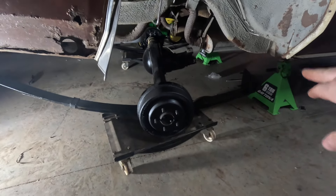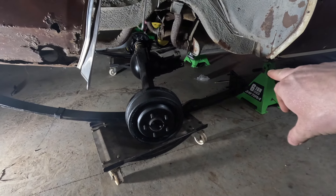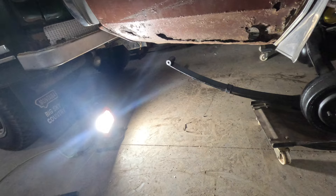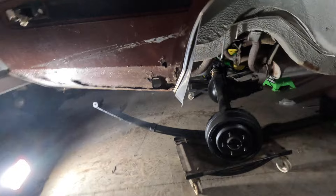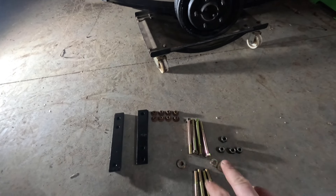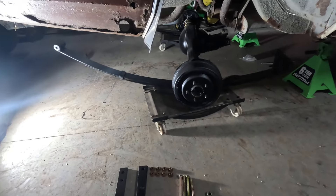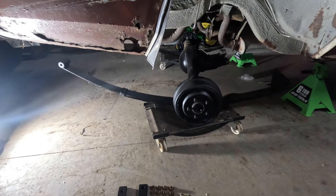I got the rear end pushed under. I'm going to start in the front and get the front hangers hung on the frame — it's four studs on the hanger mount and then four nuts on each side. Then we'll go to the back and put the shackle bolts in on the car on the frame rail and then put it through the leaf spring. That's all it is to it for hanging the rear end in there. Got my shackles here, got two different length bolts, and all the assorted hardware. Got a little better light here — let's get this thing hung.